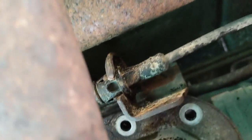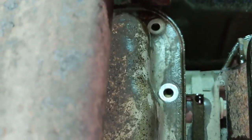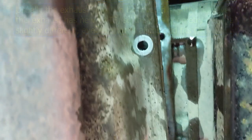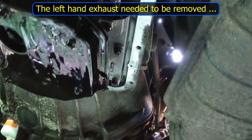The pan is still full of fluid — probably because the car is tilted back and my extraction pipe doesn't reach deep enough. I cannot get the pan past the exhaust pipe, there's just no way. The pan will come down and we can move it around, but we just can't get it over the exhaust — it must be within a quarter of an inch. With the exhaust out of the way, taking the transmission pan off becomes really easy.